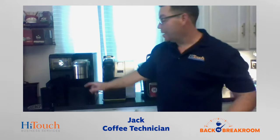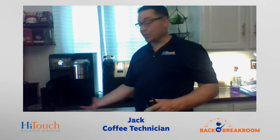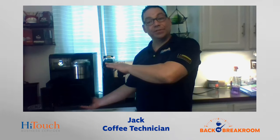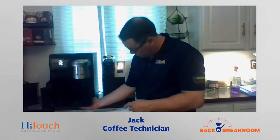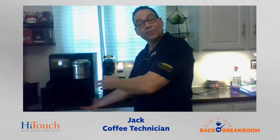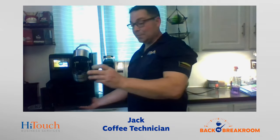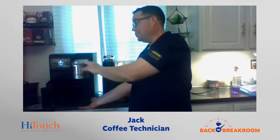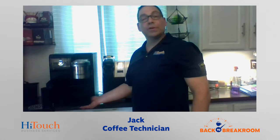Let's go ahead and start this one — I'll show you what I do here. Watch out, the water is hot. While I do this, I usually use something like Windex, which is streak-free, for the outside of the machine, but for the inside, the 195-degree water really is the best way to clean it. You'll see it's scattering everywhere because it's hitting all the interior features. The way Keurig has designed this lip, it drips and drains out to a single unit. When you're finished, take your K-cup holder, simply replace it, snapping it all the way down until the two tangs come into place. Run it one more time and you'll notice a difference — hit yes, and as it rinses you'll see it funneling directly through the K-cup holder itself, rinsing that out.